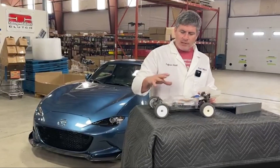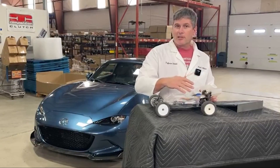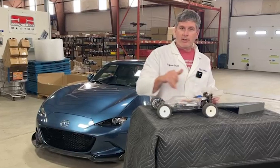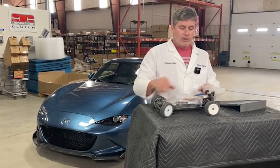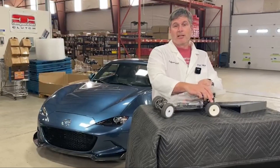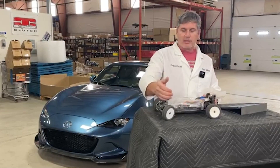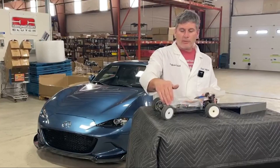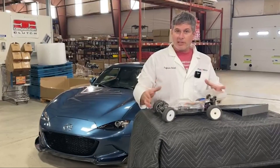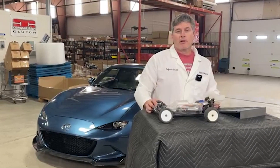A lot of this same math was used for the early ND's tire pressure monitoring system, which used the existing wheel speed sensors and steering angle sensor to do tire pressure calculations based on relative tire diameters — including accounting for inside and outside speeds through corners. It could spot when you changed tire size with no sensors in the wheels. They've since moved to a direct pressure-sensor system, but the original was the same concept: using existing information cleverly to data-mine what's going on.